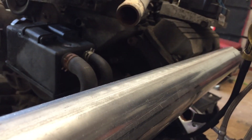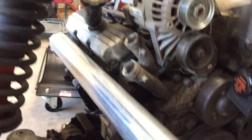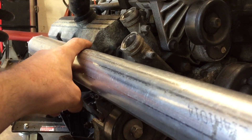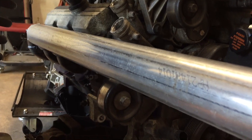Looking down the pipe and trying to match it up with the bottom edge of the valve cover. That one doesn't look too bad. On this side I did the same thing, but it seemed to drop a little bit in the welding process — you can see the edge is just a little bit lower right here. I'm kind of eyeballing it, getting it straight running down the valve cover. But yeah, we're almost done with the exhaust manifold.